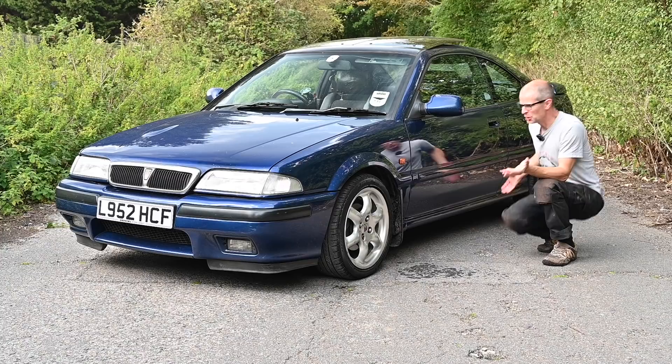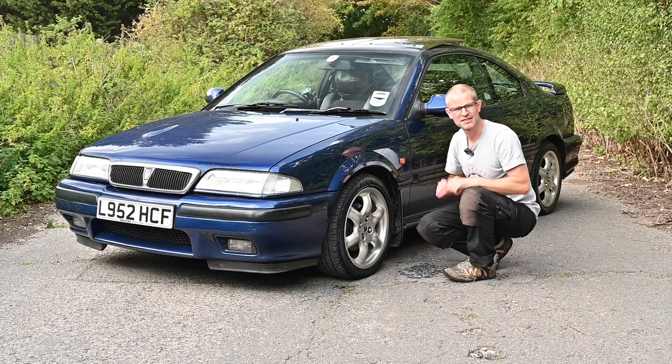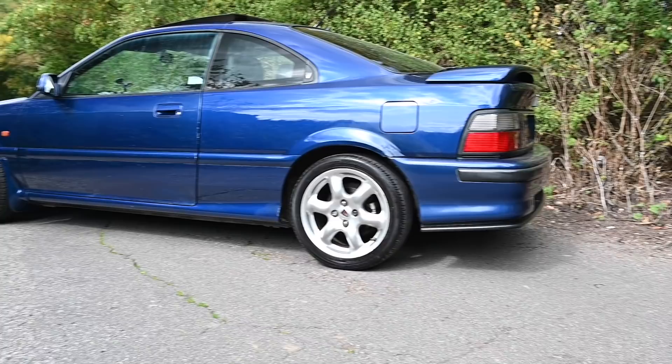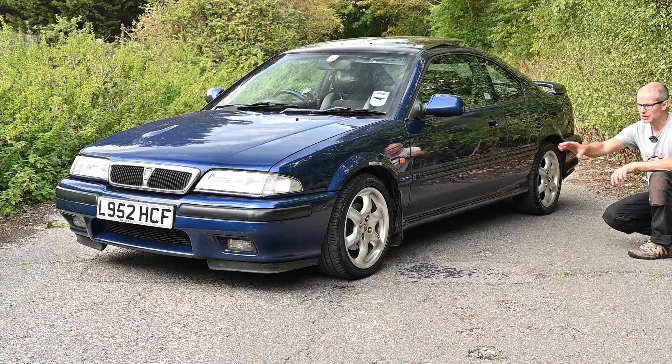So what do you reckon? The new look — it is a smidge lower, maybe even only half a smidge. The gauge for how low the car is: it was three finger widths between the top of the tyre and the bottom of the front arch before; it's now about two and a half finger widths. I think I could stand to go down at least another five winds next time I take the wheels off. It's a bit of that Rover 800 coupe look with these slightly more curvaceous wheels. The car has a very angular kind of design, so I'm not sure if curvy wheels are a good look on it or not — but I do quite like it. I'll see how it grows on me.